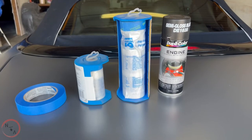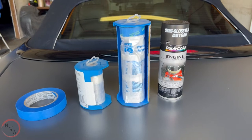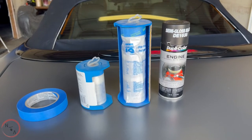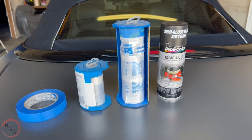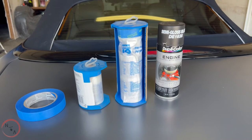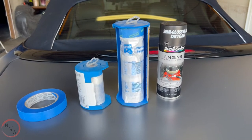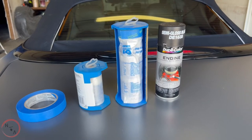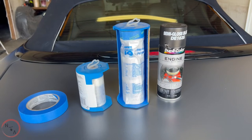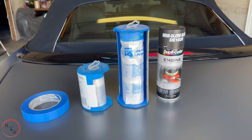The materials we're going to use to prep — after the wash and cleaning, we're going to prep it with the tape. The tape is going to outline everything that I want it to stop. If I don't want to paint over that edge, I'm going to tape it down and make sure my lines are pretty much perfect. The tape and drape is going to come into play to protect against overspray. Two different sizes — you be the judge of where you want to put it.